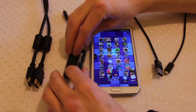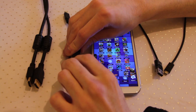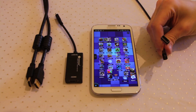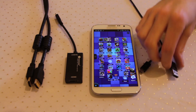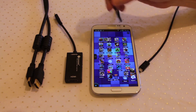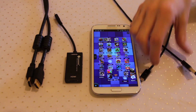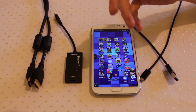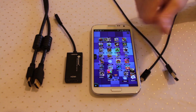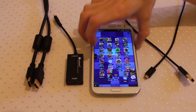The adapter requires its own power - it has a separate power piece on the side. You don't usually get any power adapter with these; the idea is you provide your own. So you'll also need a micro USB cable. You can either power the MHL adapter off a USB port by plugging that end into a PC, or you can plug it in using a wall adapter. In this configuration we'll use a wall adapter - plug it into the mains and into our MHL adapter.